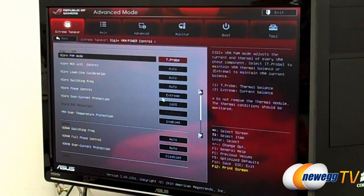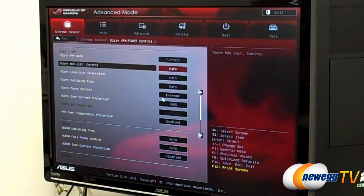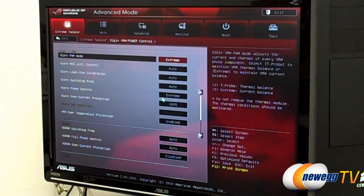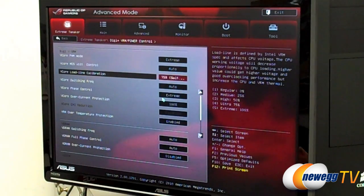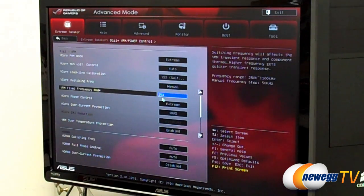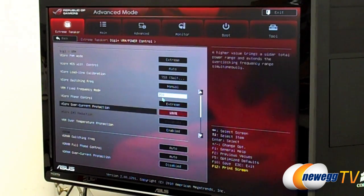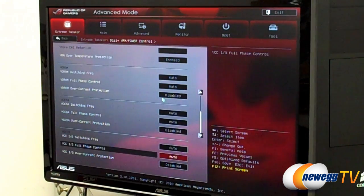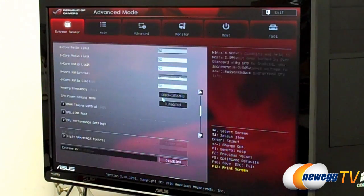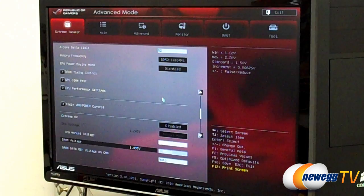In the Digi VRM options, we have a huge amount of options that correspond to the VRM, to the VRAM, pretty much all each part — giving you full control. But the board being tuned pretty nicely, we just need to enable a couple things. We're going to enable some load line compensation to compensate for any droop and make sure we get a steady voltage at this higher clock speed. We're going to bump up our switching frequency, which is going to help us drive the higher clock speeds. The phase has already been set to extreme, allowing us to use that full high-quality eight-phase array — all 100% being run right now. We're going to put 1.5 volts for the CPU and then the standard 1.65 for the DRAM.